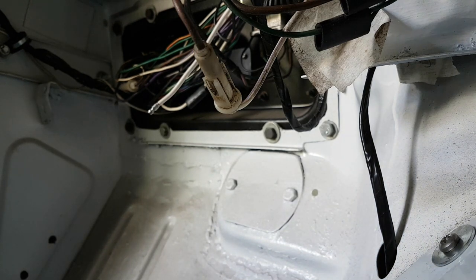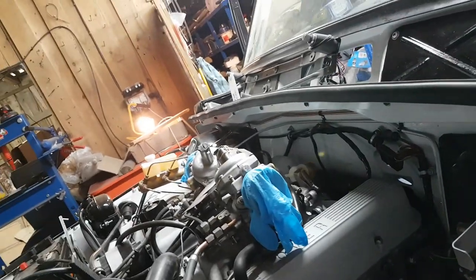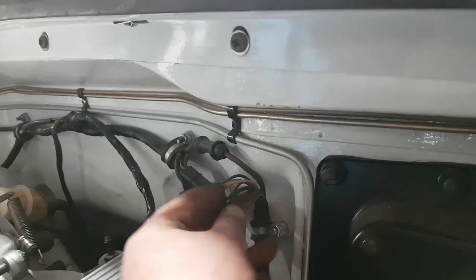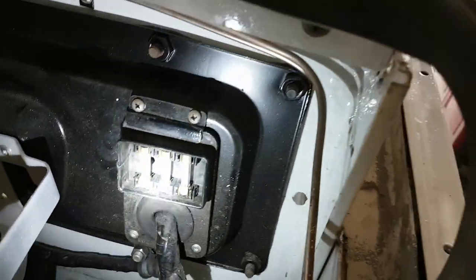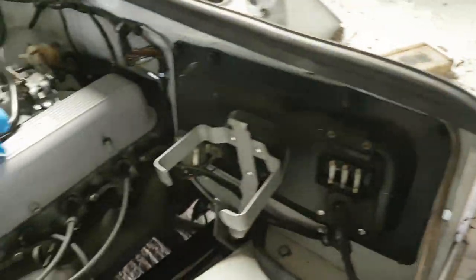I'm not going to connect the fuel pump yet because I don't need that connected up. So when it comes through here, something it uses is white. I need my torch. Right, big fat wire that comes through the bulkhead goes off to here. So I need to trace back now the thin wire that comes off the middle fuse and work out where that goes back to, because again, I'm missing a bridge on it. I don't know what the fat white wire does on that side. Let's go back, just double check that.